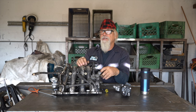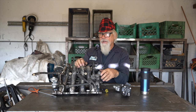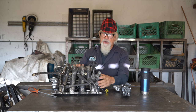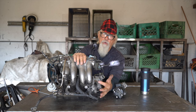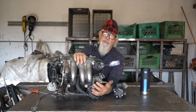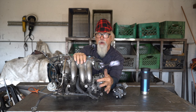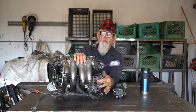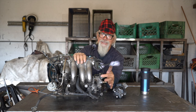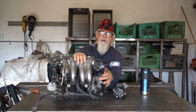When I pulled that engine, I was able to take the head bolts out with my finger - it had expanded and shrunk so much from the heat. That was my first of three 16 valves that I cooked. So I learned to remove the AC shutoff right above the ECU water temp connector - there's enough meat there for a quarter NPT tap. Go to O'Reilly's and buy their cheap gauge system with the probe and quarter NPT fitting to run a real water temperature gauge.